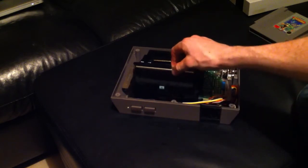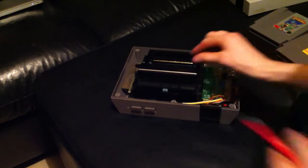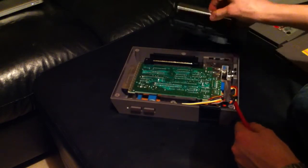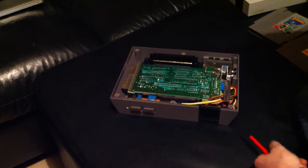The 72-pin tray wiggles out, so be careful — don't pull it thinking it just pops off, because if you break this it'll be very hard to find a replacement. Work it to and fro over the pin connector itself; it does not just pop off. If you try to pop it off, you'll break the frame.